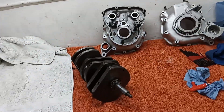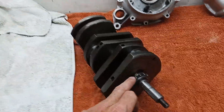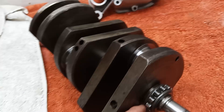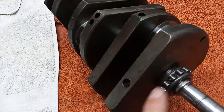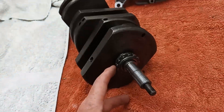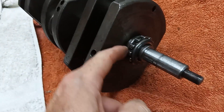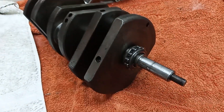As a general rule, I'd always replace the bearings and buy from a reputable supplier — don't just buy on the internet. You might get them cheap, maybe get a bargain, but I just don't think it's worth the risk. You don't know what you're buying, you could get a cheap bearing that fails and have to strip the entire engine back down again. So I've got to get this bearing off. I'm going to try to heat the bearing — not the crankshaft — and then get a couple of screwdrivers down behind it. It doesn't matter if it gets a bit damaged coming off.